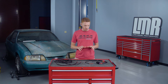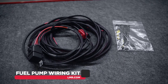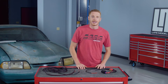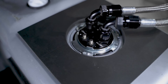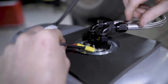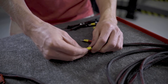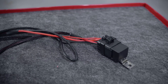If we take a closer look at the wiring harness you'll immediately notice AeroMotive's great attention to detail. Each wire is wrapped with mesh wire loom and then secured with heavy-duty heat shrink to ensure that the mesh loom doesn't fray. The reason you need this wiring harness is that with the higher amp draw from aftermarket fuel pumps such as AeroMotive's 340L per hour pump, the factory wiring size is not sufficient enough to handle the amp draw, which is why 10 gauge wire is used in this harness.